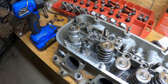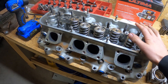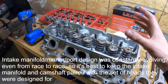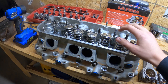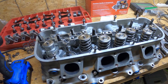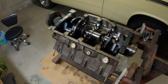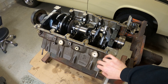The cam is actually an Arrington cam — it's got an ARE part number — but that was not the original cam that would have been in this engine when it was at Evernham. These are Evernham-machined heads. What they did with all the Cup cars is pair the intakes, cylinder heads, and camshaft together because they all work in harmony. As long as you can buy them complete as a package, you shouldn't miss the mark on power. But the camshaft being a mystery is where I want professional direction. Hopefully we'll get this block shipped off to the machine shop and start assembling before too long.